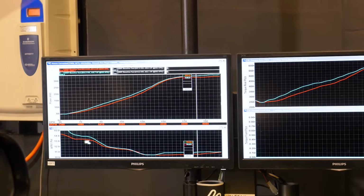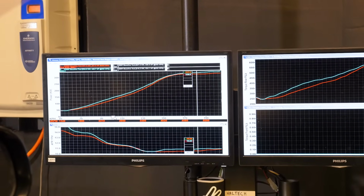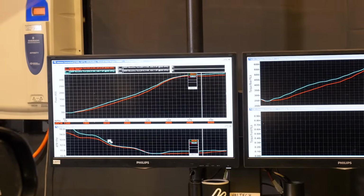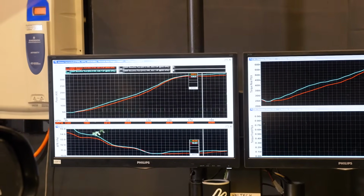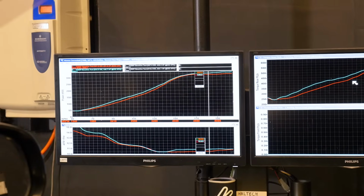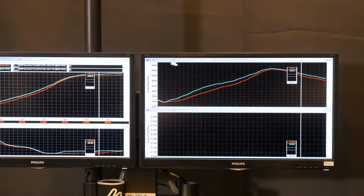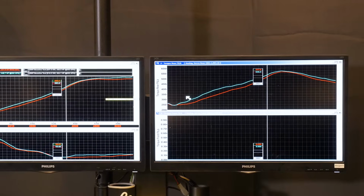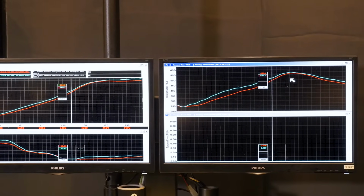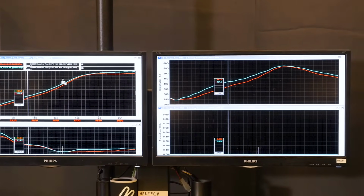In the next graph below here, we've got our corresponding air to fuel ratios. So the blue run, the slightly higher power run, the same air fuel ratio graph with the blue. The lower value with the red to show us our air fuel ratios. And then if we flick across to the right-hand screen here, we've got our torque rear foot-pounds. So our foot-pounds of torque at the rear tyre that's getting measured by the dyno. It made more torque, resulting in more power as it came on.